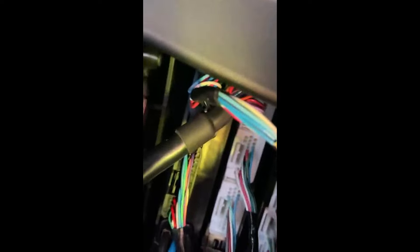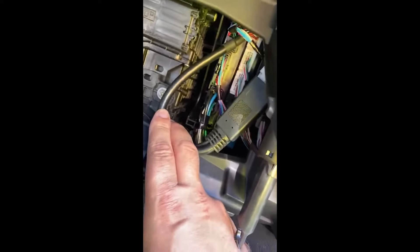This is the ADC 2021 connection point on a Corolla Cross. You can see it's that top plug right there, all the way up at the top on the CERT unit, and that is right behind the glove box. So you basically drop the glove box down, take out your top plug, plug it into the ADC 2021 right there, and then plug the ADC 2021 male end into the top plug that you just took out.